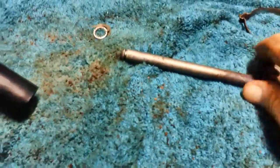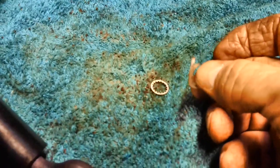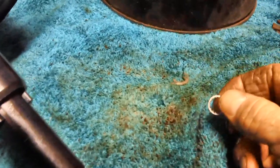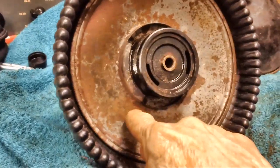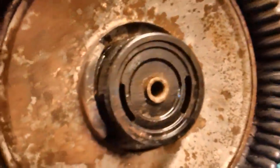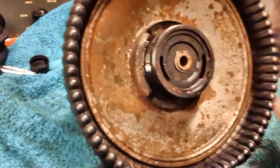This little foot thing is attached to this part right here. I have a flat punch — I'll stick it right down here and tap that baby out, going back and forth on both sides until it comes out. A little dog paw thing came out of here — it hooks to the brake pedal inside the car. It was held in there with a little plastic ring that went around it, with a little internal star washer — not a big deal. I've heated it up with a heat gun but I can't get this plate off, so I think the best thing to do is just put our snap ring back on and call this a day.